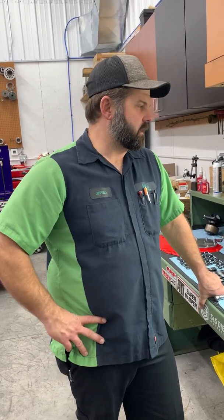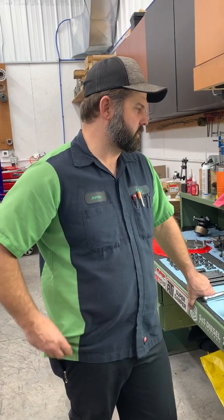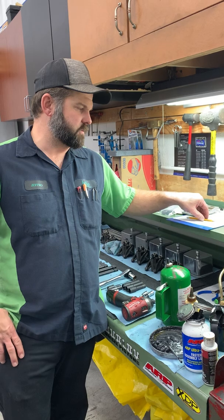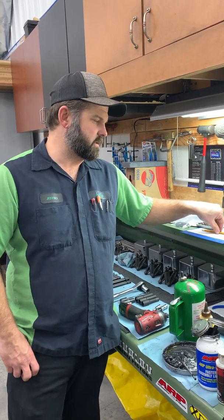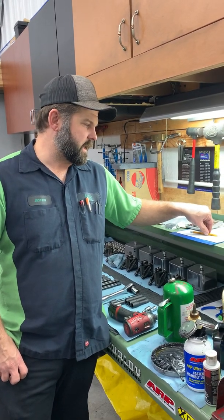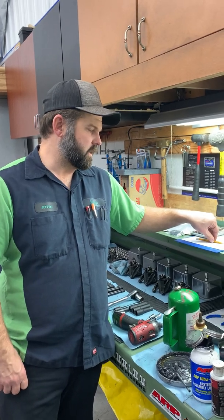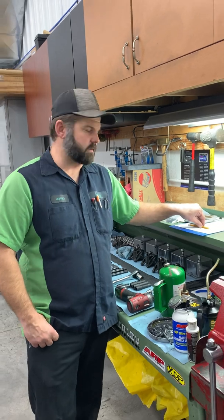Being within a degree on the average build is fine, as long as your valve to piston clearance is okay. When you're degreeing a cam, advancing a camshaft will bring your power band down, and retarding your cam timing will bring your power band up in RPM. So for the average guy, 188-220 is a pretty large camshaft, which you want on a 12 valve, a 2 valve head. They need all the help they can get with flow and air.